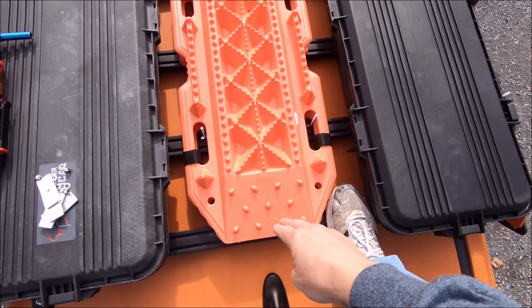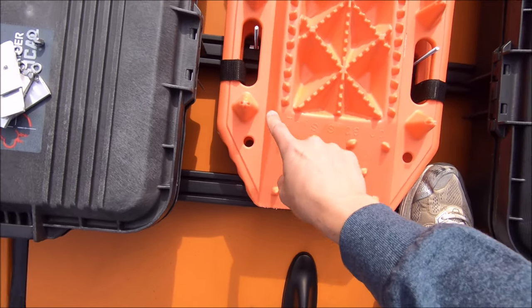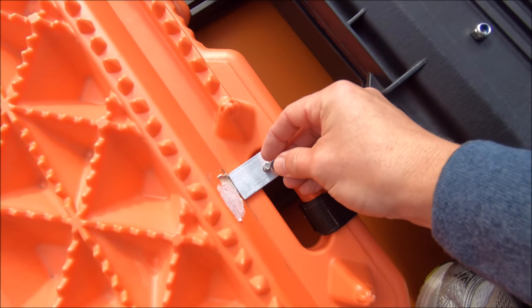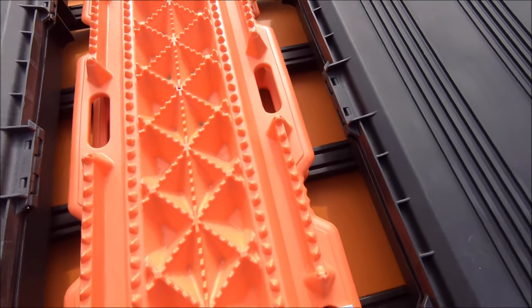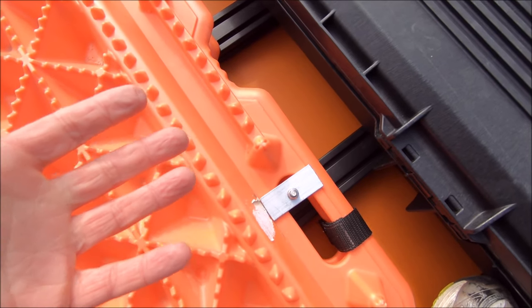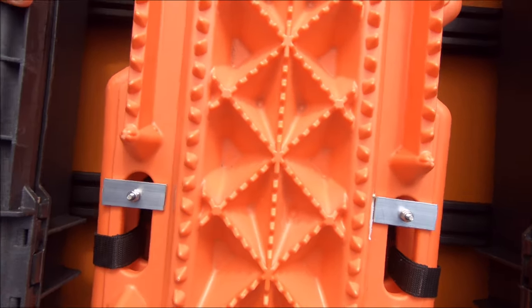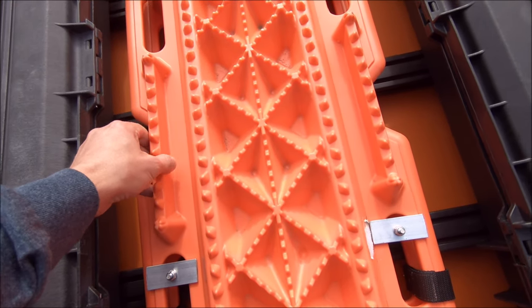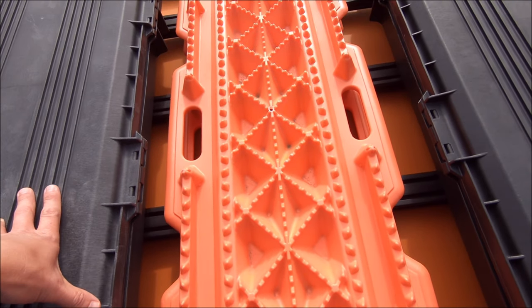Got it in place — nothing tightened down yet, but I'm using the back of this to keep it parallel with the last bar. Just making sure everything is nice and lined up and overlapping the bar even though I'm attaching it to the bar in front of it. Tightening it down so everything pinches on all four corners and it's not going anywhere. I went with the nylock nuts versus a wingnut because they are much less likely to work free with road vibrations, whether from regular driving or off-roading. You can see all four brackets with plenty of pressure to hold this in place. I've done a few test drives — about 30 miles — no noise, nothing like that. The only thing to be aware of is these grooves provide great traction off-road but will collect water, and you can't really avoid that. But there is the final product.